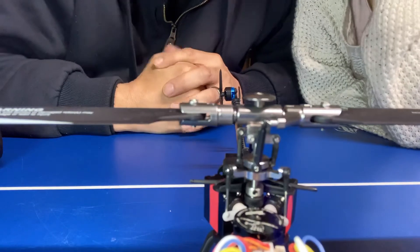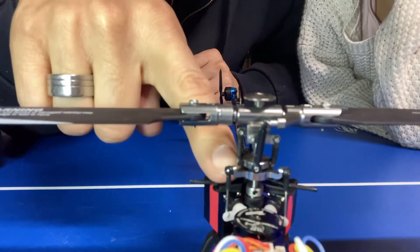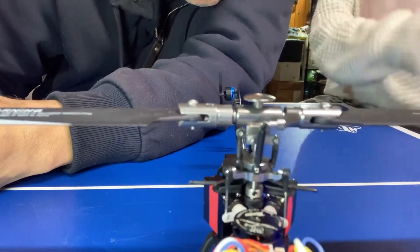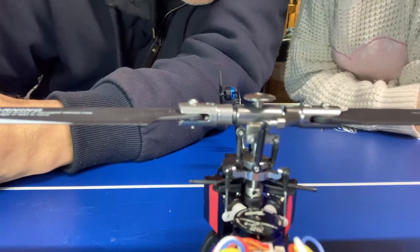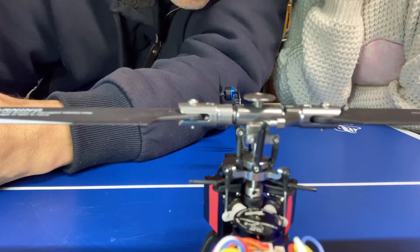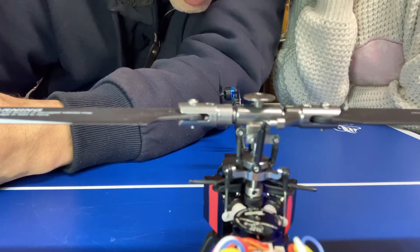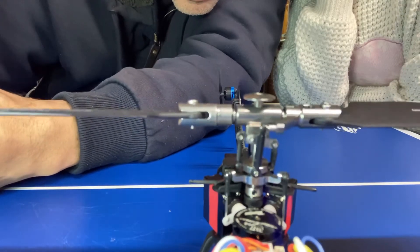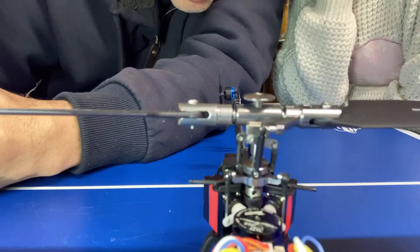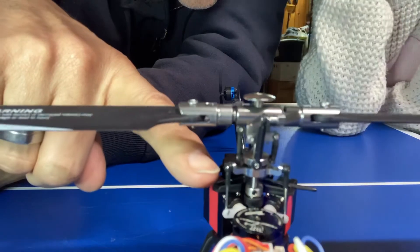This is a collective pitch helicopter. You have pitch, roll, and elevator, which gives you three points of control on your swashplate. So you can move it left and right, move forward and back. In addition to those controls, which help you maneuver around, you also have the pitch control. So when you give your helicopter throttle, not only are you increasing the speed of the motor, you're also changing the pitch angle. And this is what helps you go up in the air, or if you're flying inverted, helps you stay up in the air while upside down. So negative pitch, positive pitch — you'll notice the swashplate is moving up and down.